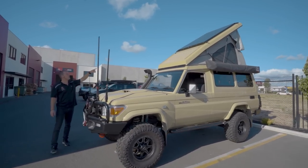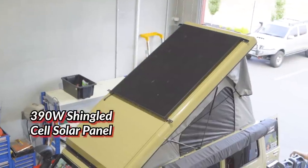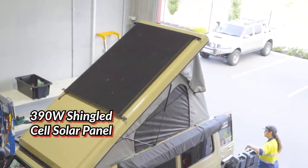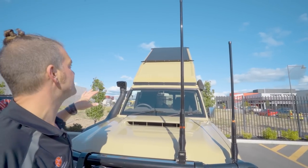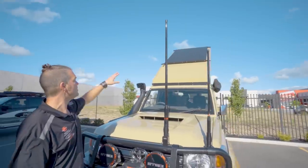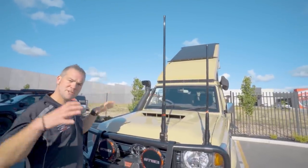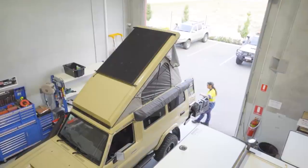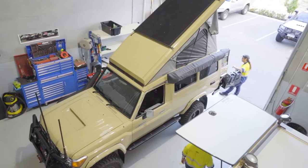We've also got, and that's the first time that we've done that, a multi-segmented, or also called shingled, panel on the roof. This is the first time that we've done that on these cars. We have put one of our big house solar panels on there. This is a multi-segmented, also called shingled solar panel. So what you're looking at is basically 20 individual solar panels just put into one panel, which is awesome for shading tolerance. So if one of these little segments gets shade on it, the other 19 segments can still work